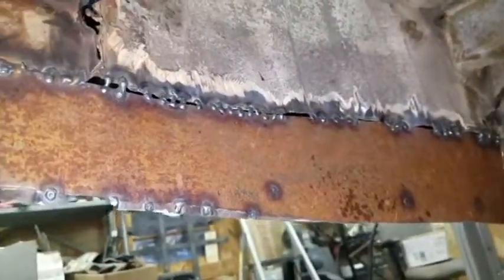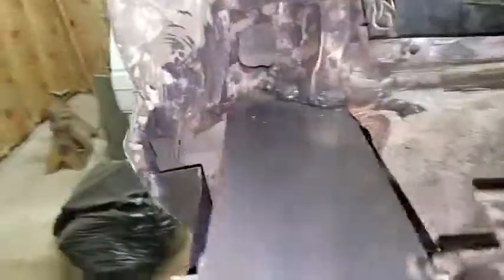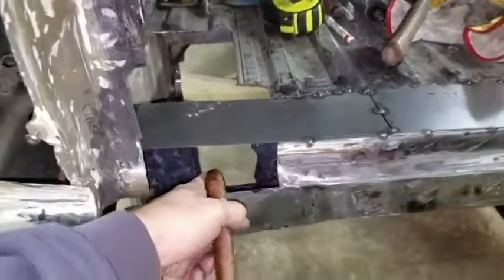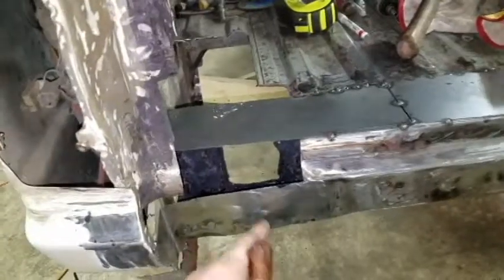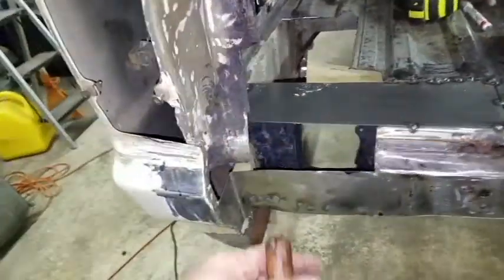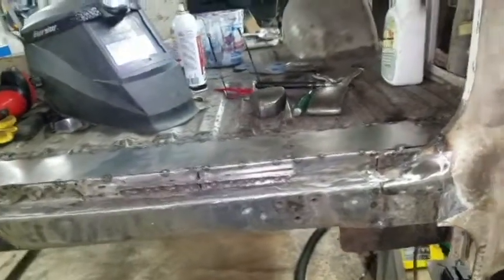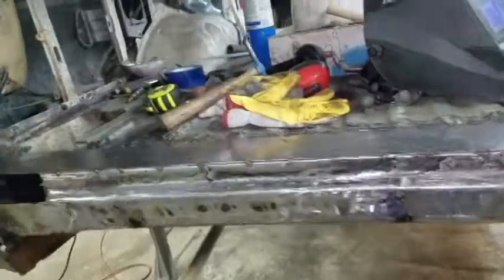The cutaway behind the wheel quarter panel was all gone. I've grafted in a new piece on the inside — I'll put some rust converter in there, that'll take care of the light surface rust. All the rest of this was gone too; I had to cut that away and beat out the panels on the inside. It was all smashed. I had to use a hammer and a dolly to straighten it out as best I could. Then I had to cut away the entire rear valence, side to side. One of the access panels to the rear frame bolt was gone. There were holes all over the place back here — this big open channel just filled up with dirt and debris, about half an inch of crap inside, holding moisture.